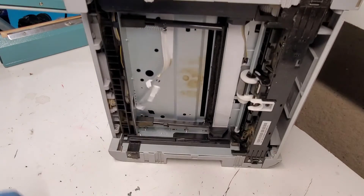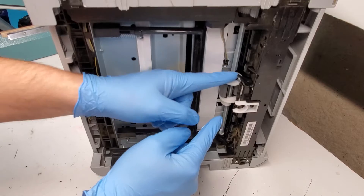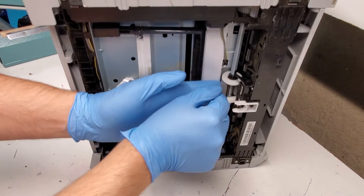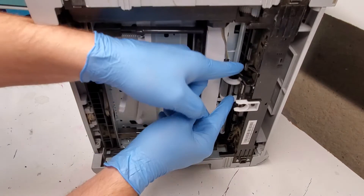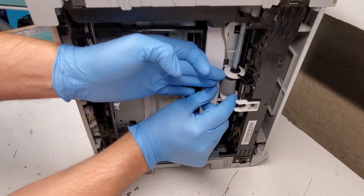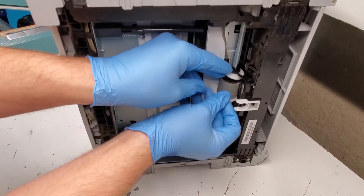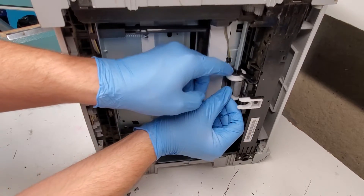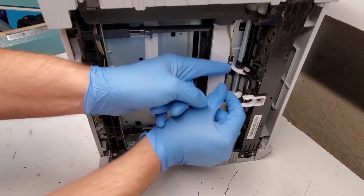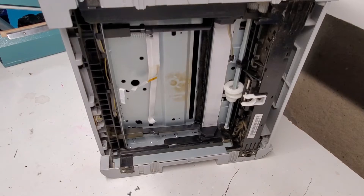This is our laser unit. To remove the pickup roller — just to clean it or if you're replacing it — you need to press this tab, pull it away, right here. You can use a fingernail or a flathead screwdriver. Pull the tab back and push this wheel up like so, and then you can just take this roller out. It goes in between here, twisting it, and putting it in place when you're putting it back. And that's on a lot of the Samsung printers — it's going to be very similar to this.